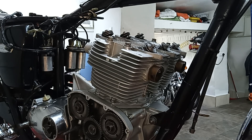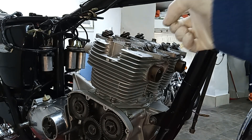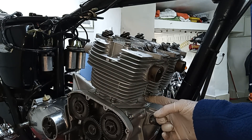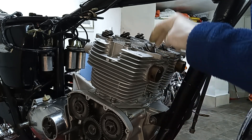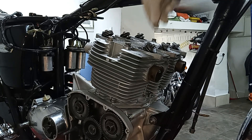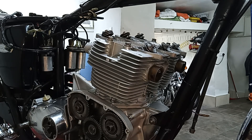So we just got to get the rocker boxes on, and then we can torque the whole thing down. But obviously we need to get the rocker boxes and the push rod tubes on at the same time. And you can see from that why I've put the well seal on the bottom of the push rod tubes, because obviously this bit of the head is now in the way and it's very hard to get the well seal on the back — it's just easier to do it that way. You can probably put a paintbrush down the top, but it's just a bit easier if you do it first. So the head's on. Those new dowels didn't seem to go in straight into the head, and so they didn't want to go into the apertures in the head, but it's on now and it's fully seated. So we're okay. Jolly good.